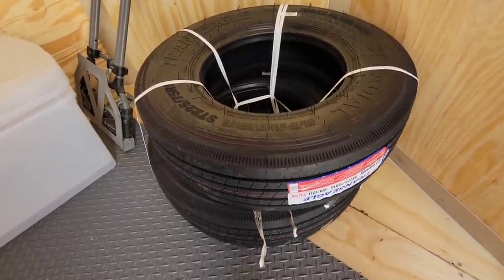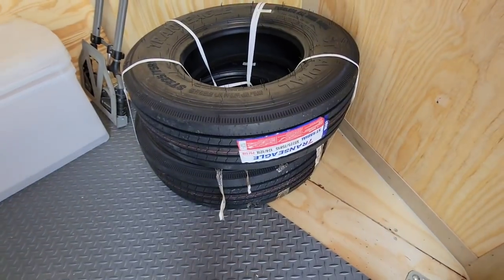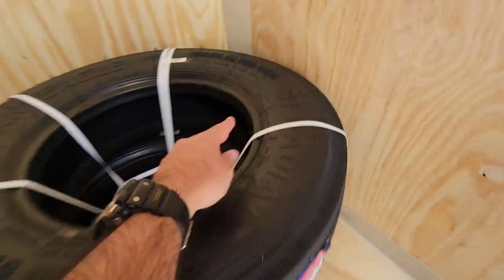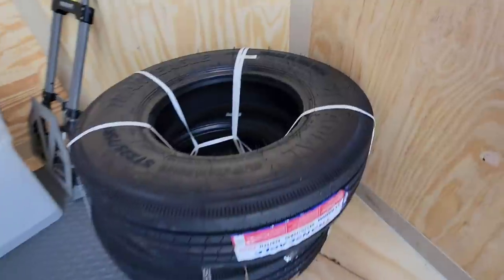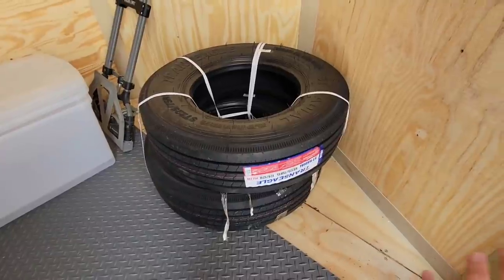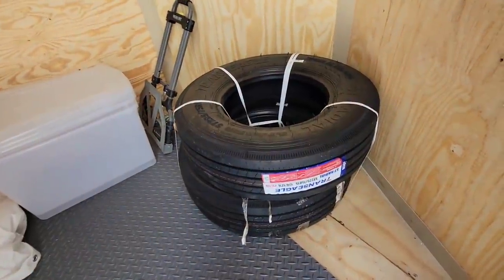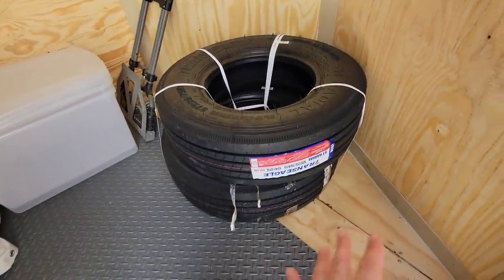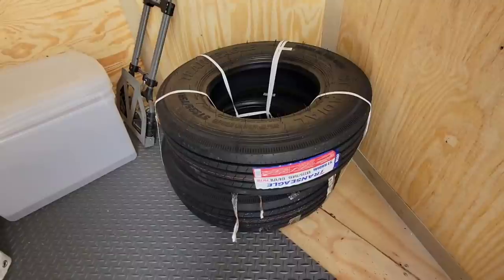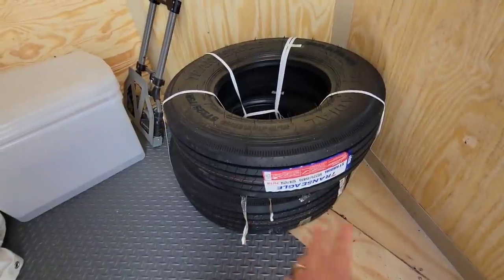This is a significant step up. You can see there's still a little bit of sidewall flex when you press in on it, but you can see how thick the bead edge is. It's going to be very interesting to see how these perform. I'm 100 percent aware these will make the ride inside of this trailer stiffer, rougher, firmer — I completely understand and I know what I'm getting into. I want to see what type of change it makes and what happens when these are aired up to 65 to 80 psi.